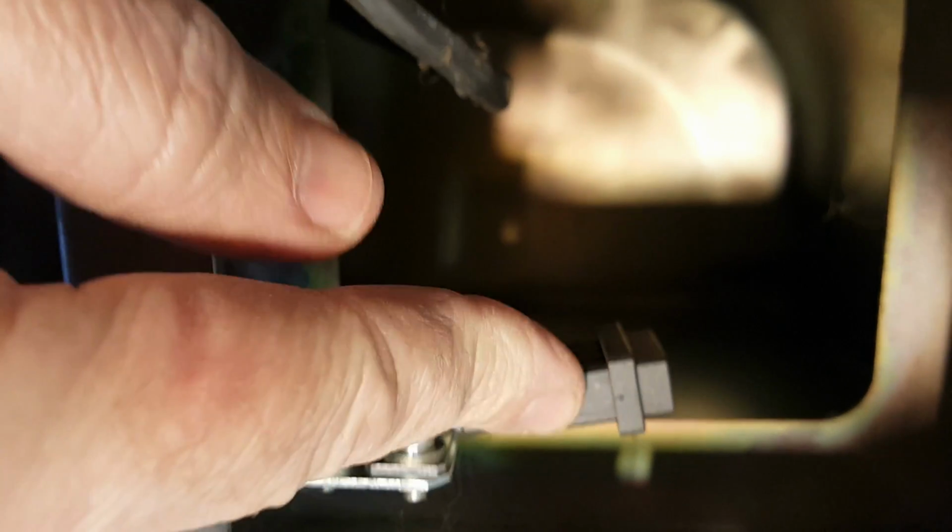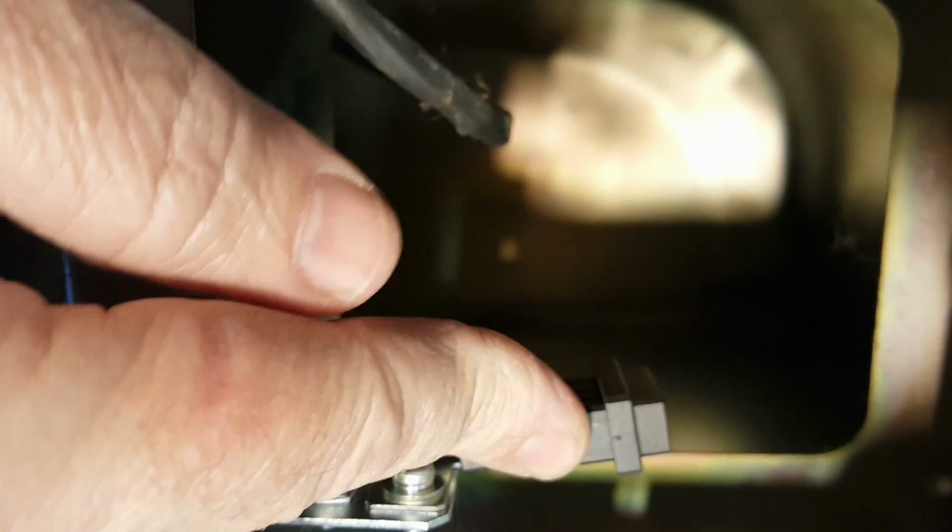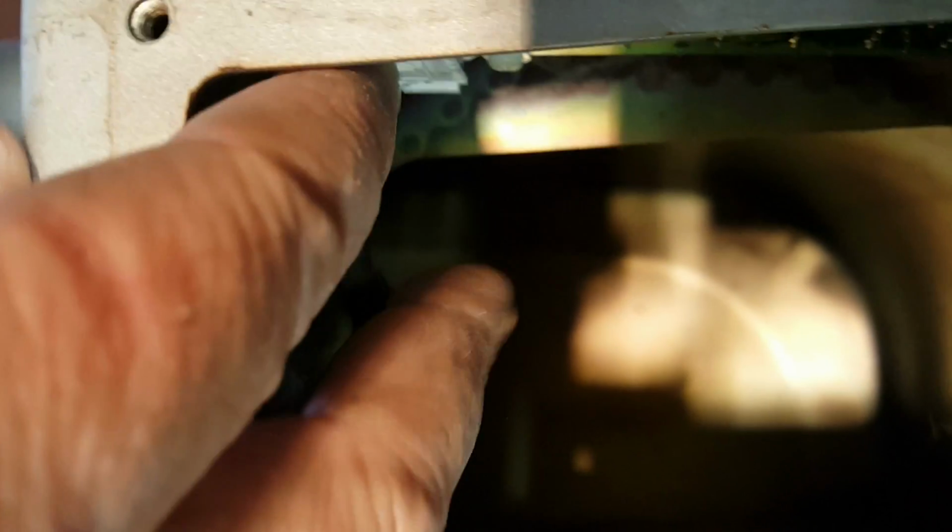So one note, Daryl's step-by-step makes note of this connector, and he says it actually goes to the LED display. What this is actually to is the paddle assembly, the paddle receiver. There is another connector, so there's actually two connectors in here, and this is the one that goes to the LED display, and that one also needs to be removed before you can slide the charger out of the cover. I had that trouble, and then I noticed that it was binding up right here.